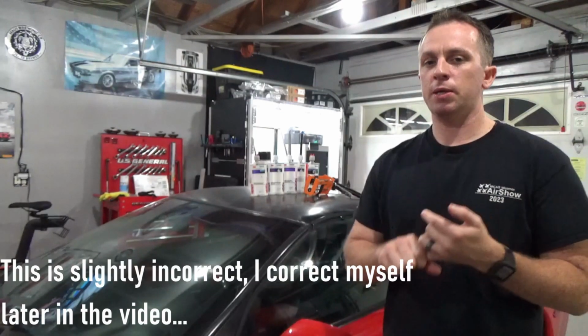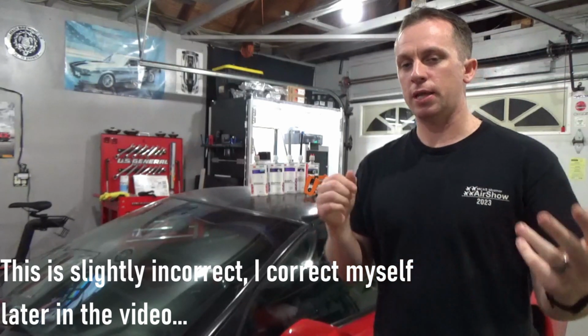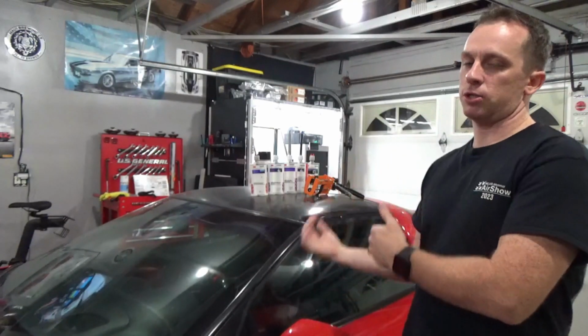When you're looking at this car, all of the body panels are made from really three main groups of materials. The first being fiberglass, the second being something called a sheet molded composite, otherwise known as an SMC, or a fiber reinforced polymer, FRP. And because those materials are a bit unique and the manufacturing process to manufacture body panels using those materials is unique, either to pop them out of the mold faster or just to lay them up a little bit easier and faster for mass production, that means that you have to use specialized body panel materials to repair this car.